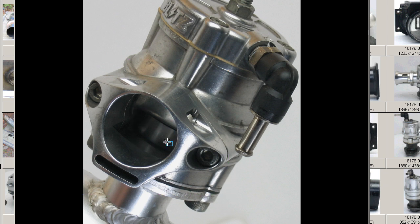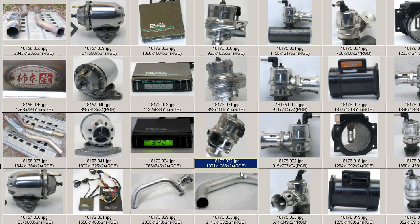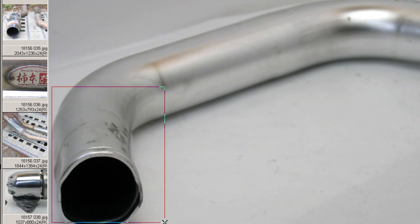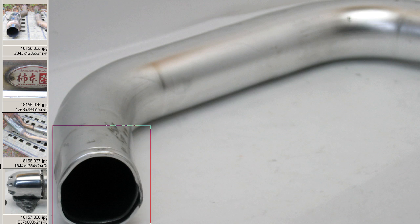You can see the little piston inside there. The piston is in the down position, of course. That piston rises up when the boost from below pushes it up and releases the boost pressure through the little gap and out the trumpet. The end of the flange has been removed fairly roughly, as you can see — there are a few little dents and marks in the end of the flange here, but it's still in good working condition.